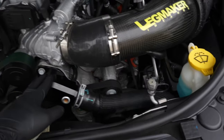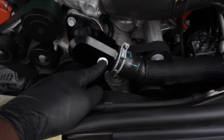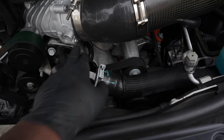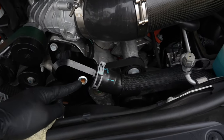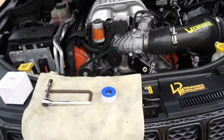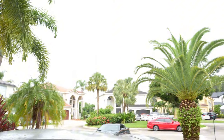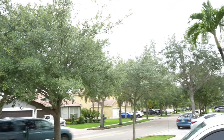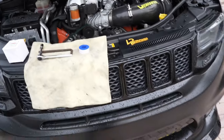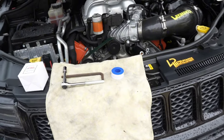The thermostat housing is three bolts. You take this bolt out and this bolt out right here, but there's another bolt after you take this out — it's another bolt in there that's holding the thermostat housing. I'm just gonna take this one out and let some of the coolant come out. The car has been sitting overnight so it's nice and cool. Look at the Florida weather — it looks like it wants to rain, I hope it doesn't rain on me right now. The car is nice and cool, we don't have to worry about air going in the system.